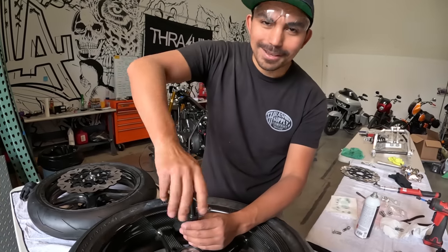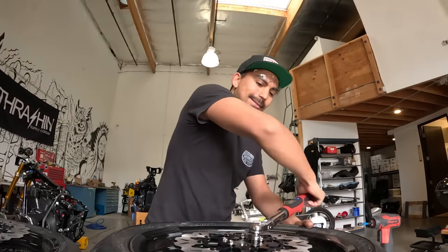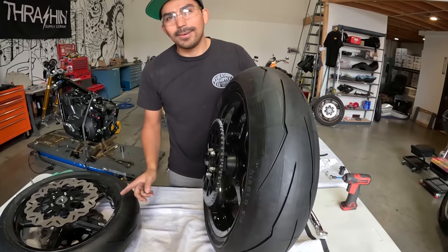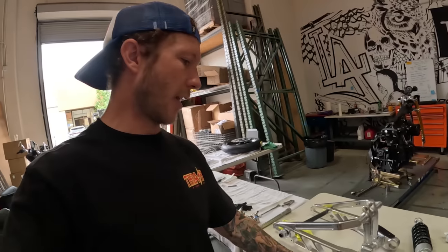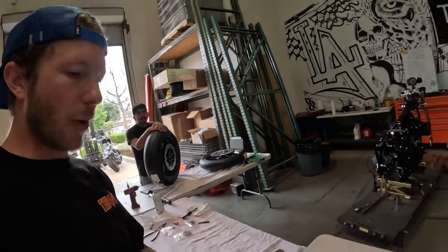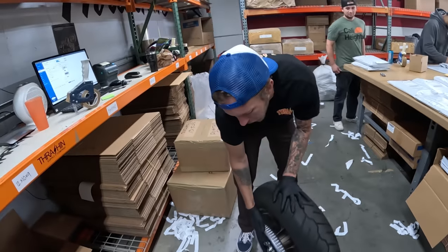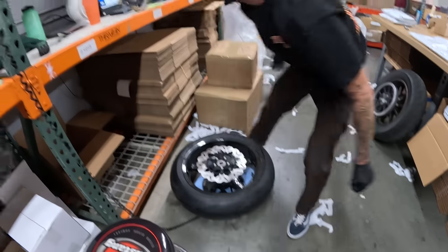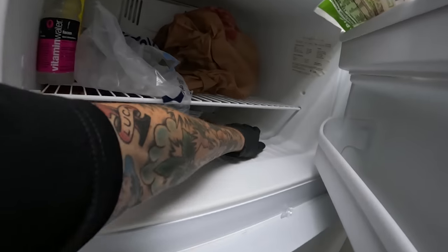You didn't do this side — this one's tight, you didn't switch the bit. It shouldn't go in this hard. X-pattern done. This one was 24 — 28.5 pounds. We're gonna get those weighed. On that side of the shop is our freezer — I'm gonna bring these spherical bearings to freeze before pressing them into the swing arm. 45.5 pounds stock — 28 pounds for the new wheel. That's unsprung weight, so it makes more of a difference in handling and rotational mass — it's gonna make the bike accelerate fast, shooting for triple digits off this bike.